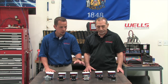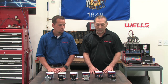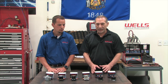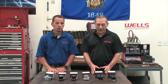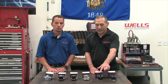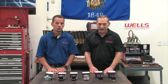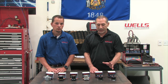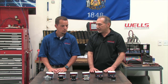The most common call we get is concerning the wiring of a solenoid. Typically when somebody goes to replace a solenoid, they take the wiring off and oftentimes get confused as to how to make the connections. The positive battery cable should be attached to one large post on the solenoid, and the load — the starter itself — should be attached to the other large post. That starter cable should be alone, no other wires attached. If there are any other smaller fusible link wires, those all go on the positive battery cable side of that solenoid.